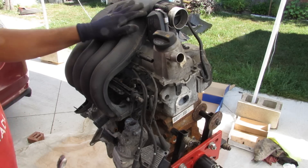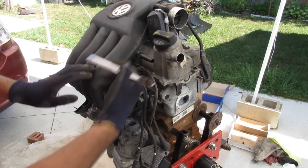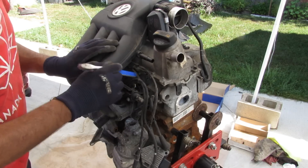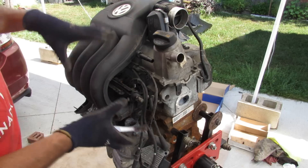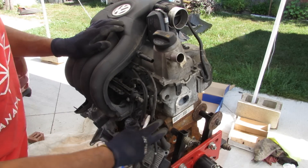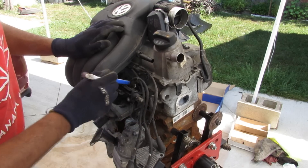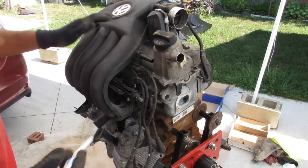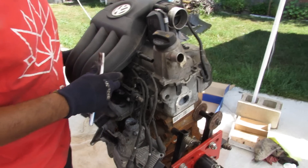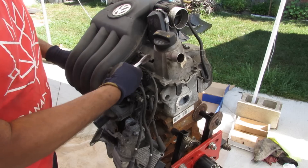Taking a quick look around this engine, we do have this plastic intake plenum with really long runners that curve around the fuel rail and the spark plugs, instead of just putting everything in the front. This engine is pretty old school because it still uses spark plug wires with a single ignition coil, instead of using coil-on-plug technology like many other manufacturers have done many years ago. It also makes spark plug access a little bit more tricky.